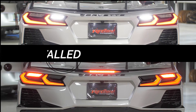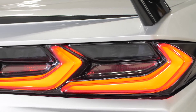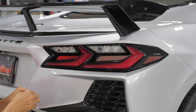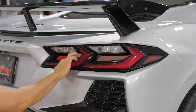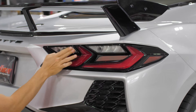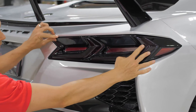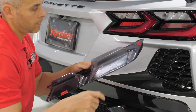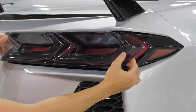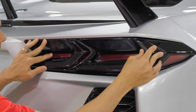The covers are securely installed with clear 3M VHB double-sided adhesive tape. This means you will not have any tape blocking the light output when the covers are installed. Simply clean the entire tail light and side reflector area with the supplied alcohol wipes and allow it to dry. Before removing the red 3M VHB tape backing, familiarize yourself with how the cover will install over the factory tail light. Once you're comfortable with that, remove the red tape backing and start with the outermost side of the cover to the tail light. Install it flush and tight up to the bezel where the lens will sit flush with. Press down on all areas where the tape will bond to the light. That's it, you're done with these.